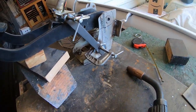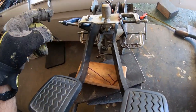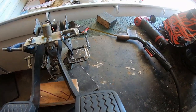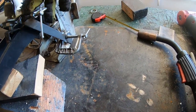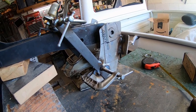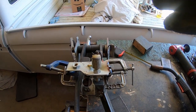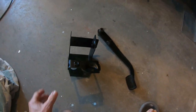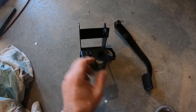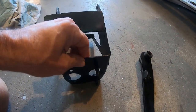I've put the pedal box on the table, popped the pedals where they're supposed to be, I'm putting a brace to relocate the switch down, then I'm going to tack this side. I'll put it back on the truck, re-test everything, and make sure everything's right because there's some adjustment in the pedal. I'm going off my sharpie marks. Hopefully I got it in the right place, and now I should have room for this switch to clear the power steering motor. Here's the completed pedal box assembly — I reinforced the top, relocated the brake light switch and the clutch pedal stopper, and painted the inside. I repainted the clutch pedal and brake pedal flat black.